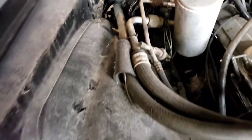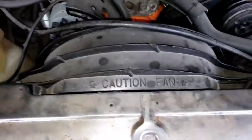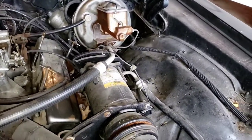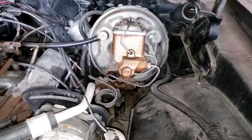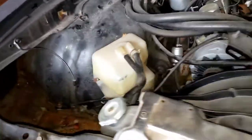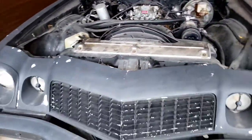The firewall is good, there's no holes in it. The wheel wells are good. Even the battery tray — it's rusty, because battery trays always rust, but it's not falling apart, which is crazy. The air cleaner is missing — it's in the back seat. Down here the frame is good, it's not rusted. The brake booster's good, distributor's good, the AC looks good. I checked the fluid — it is full. The reservoir appears empty, but I'm going to be emptying that out anyway. I do have to check the oil. Yeah, it's pretty clean in here, so I'm super excited about this.